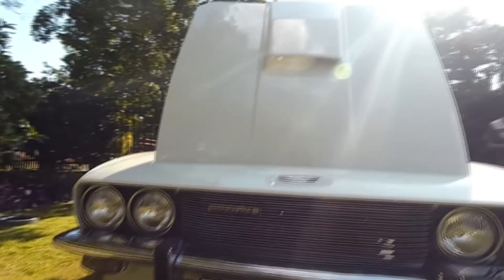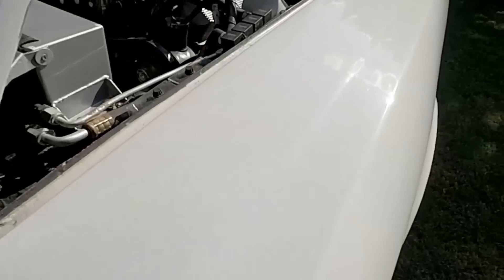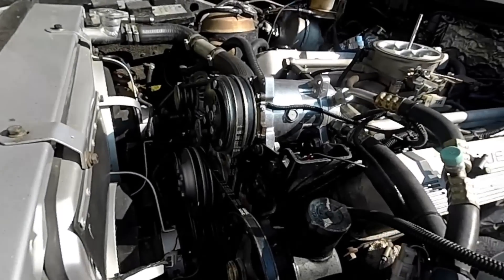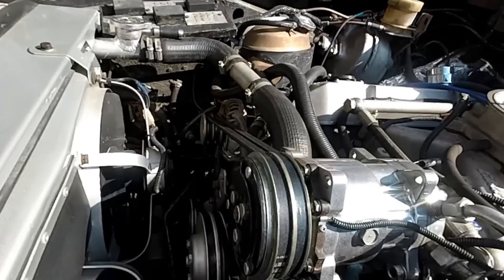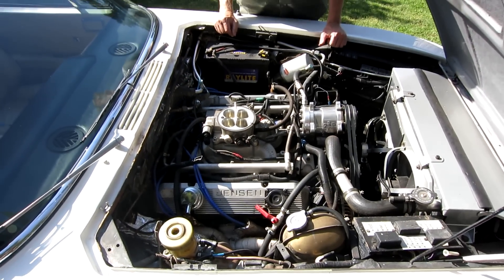One of the main objectives for everyday driving is to have good fuel economy. Whilst the original Carter carb was excellent, it can't compare to fuel injection with electronic control, so a fuel injection conversion was done. This was based on custom components and a MegaSquirt 2 ECU.